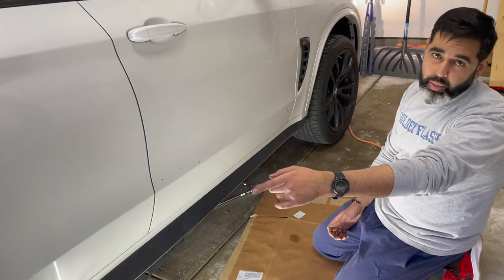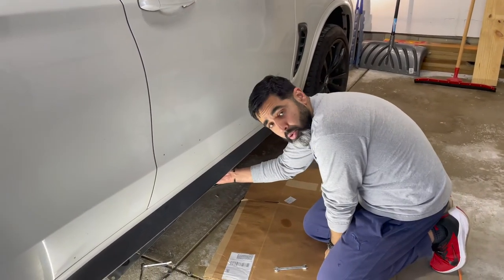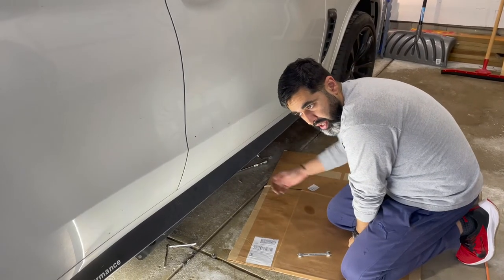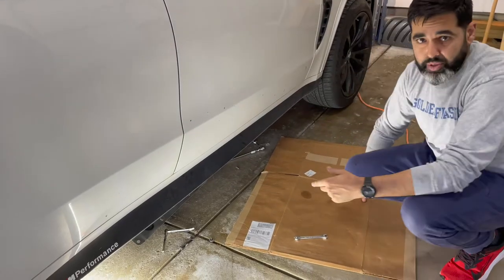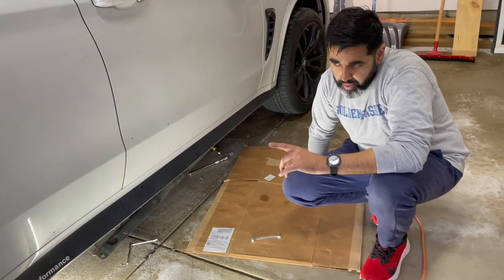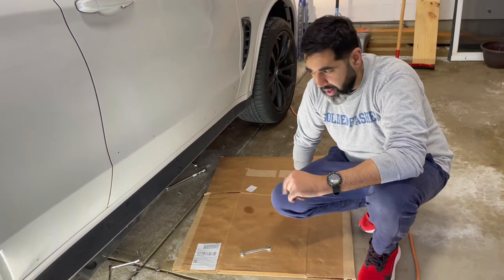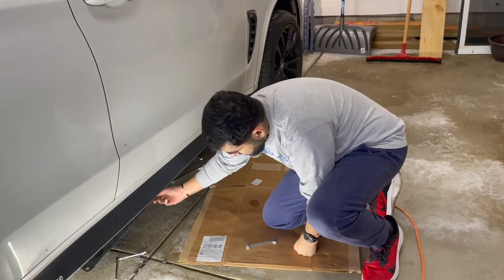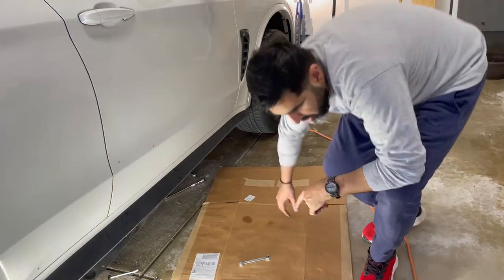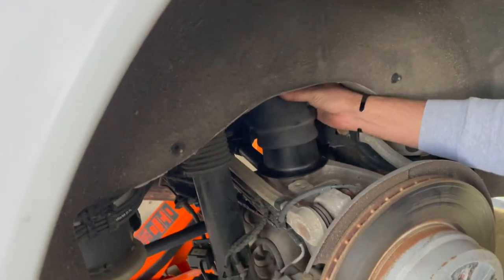We put the second one back in, the new one, and came back here, attached the blue and red lines, attached the two connection points, and basically, since the car has been sitting, I didn't see the air coming on, so what I did was I ran the car, you can hear the air come up, and filled the airbags, the air suspension on the back. I have not closed this yet, I'm just waiting to make sure it fills up first, and then I'll close it, but let me just see, because if you look here, the airbags are not fully filled up yet.